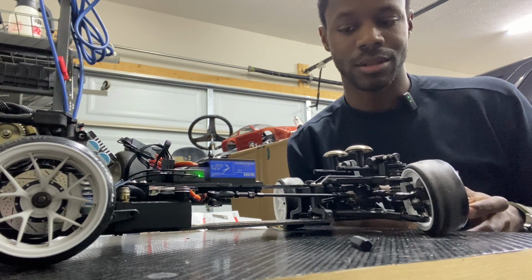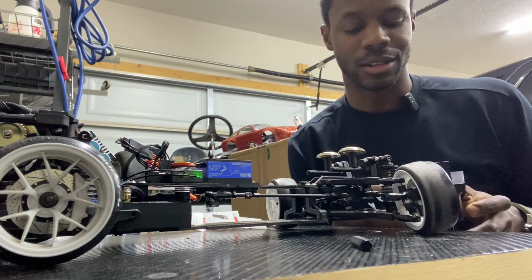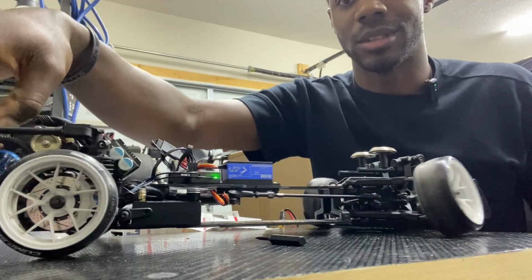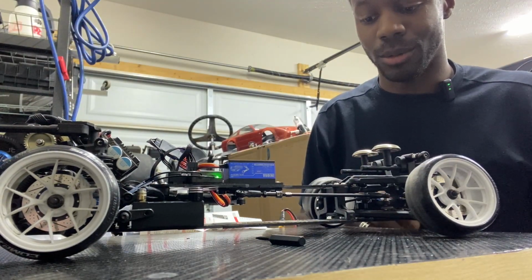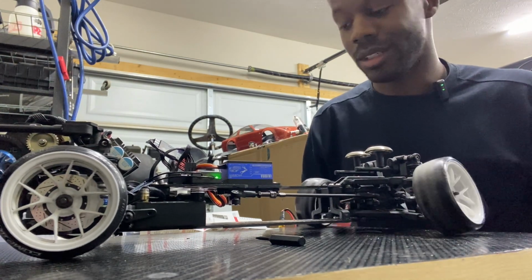And once you complete that, once you know that you've gotten full steering left but not oversteering on the left, you go ahead and push the button on the gyro. Now over here you see me rechecking everything, make sure it's good, but now I'm steering and the wheel is returning very slow. I'm not doing that. The gyro is doing that.